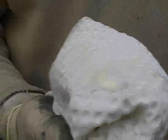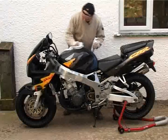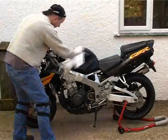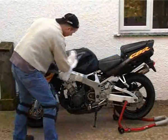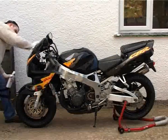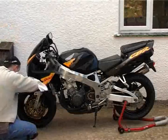Put the polish on the cloth and you'll get less polish collecting in the cracks. I'm starting with the cleanest bits and working my way down. Apply more pressure and you'll remove more scratches. Don't be afraid to use plenty of polish, but because it's abrasive you shouldn't use it on your screen as it will dull it eventually.